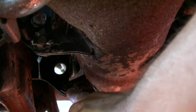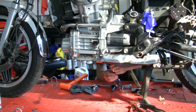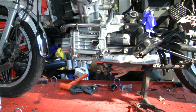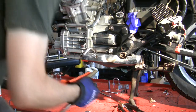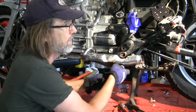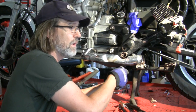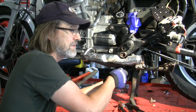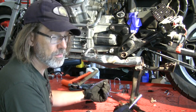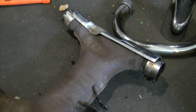Hard for me to film this, but just know those are the three bolts I'm taking off. For this front one I can only get a box-end wrench on it, so I did spray a little penetrating oil on that first. The rear two you can get at with an extension and a 12-millimeter socket. The nut is welded on the back of the piece, so it's just the bolt coming out — two bolts at 12-millimeter and the one bolt-and-nut on the front. It dropped right out the bottom real easy, so just pull that piece out.